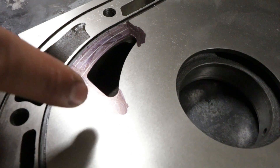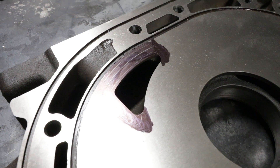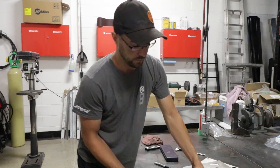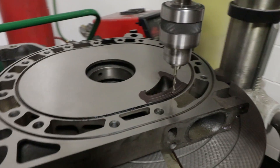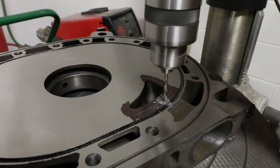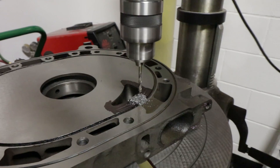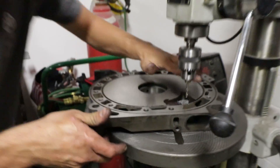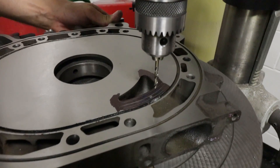As you can see from these marks, the ports are obviously a bit bigger and you can see where the bridge port is going to be cut. So what do you cut those with? We'll start with the bridge port. What I'll do is take this over to our drill press. So I'll go along now and drill about five or six holes side by side.